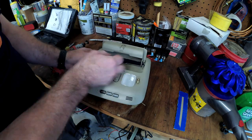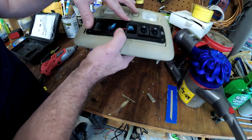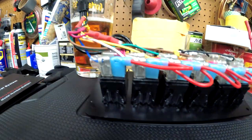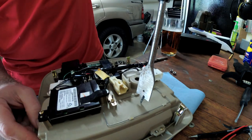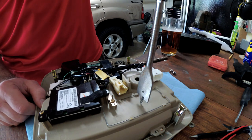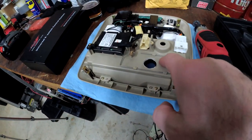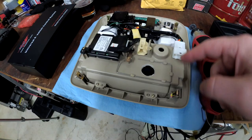I'm definitely going to have to cut the back side of the sunglass case here — it's going to be tight. Got all the wiring on the switches in the switch panel with flag connectors, so it's pretty low profile compared to what it was before. I'm not cutting the back out of this thing because of the flag connectors I've got, but I do need to drill one hole for the wires to come through. I think this is the antenna for the home link, so I'm going to drill it right in the middle of that and make it nice and big so it's easy to get things in and out. The wires are getting all bunched up inside the housing — the switches can fit but they can't fit with any of that excess wire harness. I'm going to cut as much of this out as I can, which should give just enough space for that wire harness to push in up above.